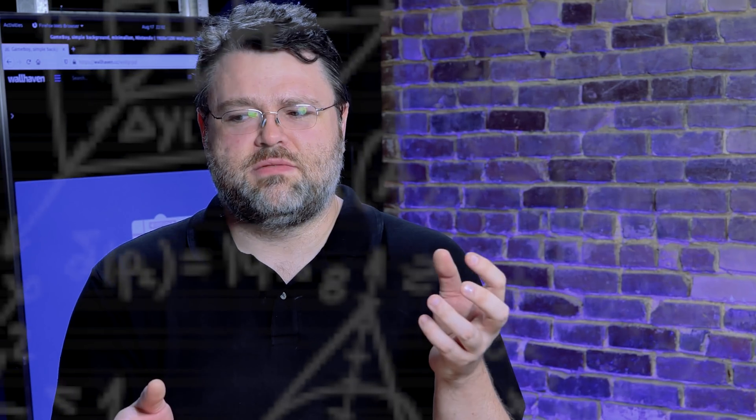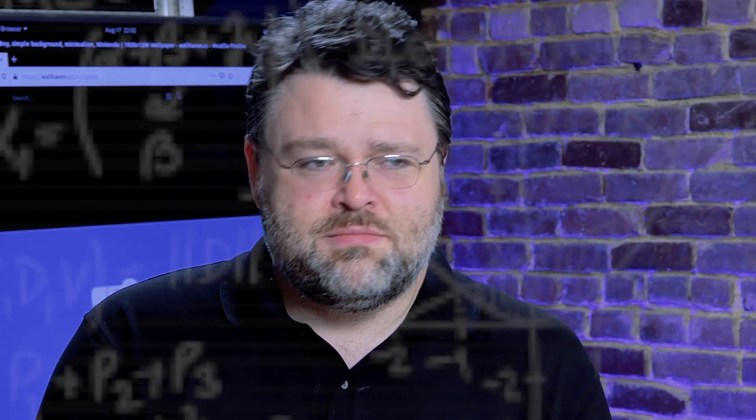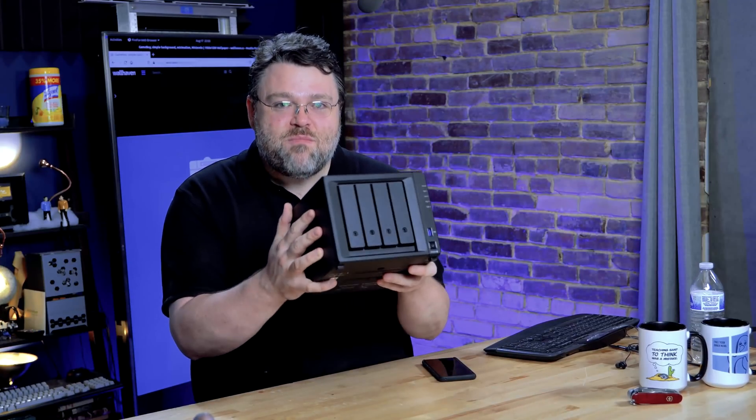As a fun aside, if you haven't looked into how mechanical hard drives work — every time I think about the information density on mechanical hard drives, they're basically Rube Goldberg machines of data storage. It's a spinning magnetic disk with a ceramic electromagnetic read head held above the magnetic disk by infinitesimal distances by the Bernoulli effect. Sometimes we have to use helium because air is too turbulent. Then we have heat-assisted magnetic recording, which might use a laser to heat things up because a regular magnetic field won't take unless we have a strong magnetic field — but we don't want to flip nearby bits, so we use a weaker magnetic field as long as it's hot, using a laser. Then things get sort of crazy from a quantum mechanical tunneling standpoint. They make the bits taller into the recording magnetic substrate. It's really just insane how mechanical hard drives work — and it always blows my mind whenever I can do something like 50 terabytes in a tiny cube.